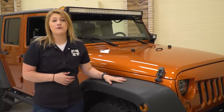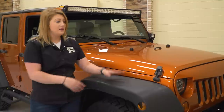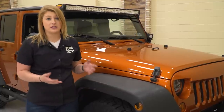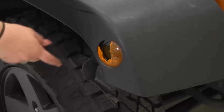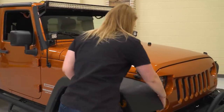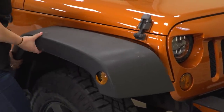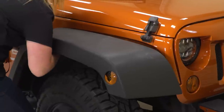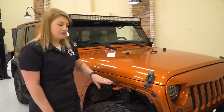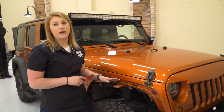Now we're ready to fully remove our front fender. Make sure you disconnect your marker light. You can disconnect it from the harness attached to the front of the Jeep or you can just remove the bulb. Either way, you want to make sure that's disconnected so you don't rip it out of the harness. We've already removed our marker bulb because of the damage on our fender. You can just pull up on the fender and pull outward — it should be pretty easy to remove. Sometimes these clips do like to stay in there after you remove your fender; you can just pop those out with a trim removal tool.